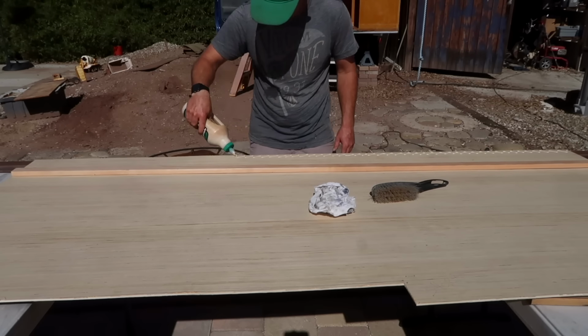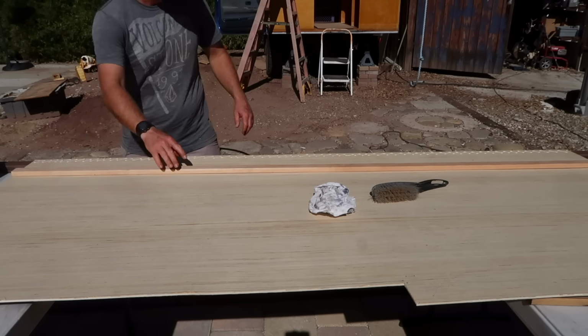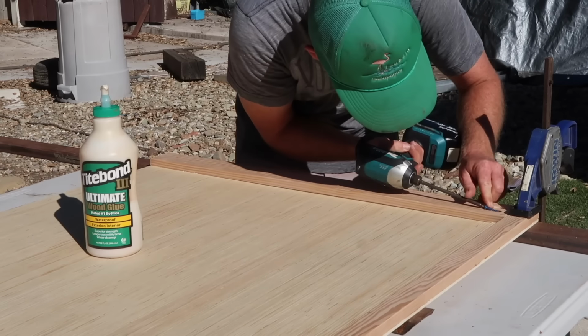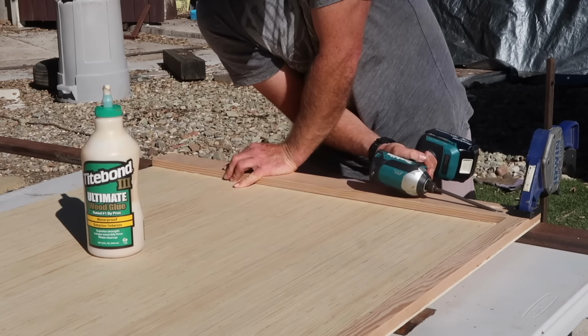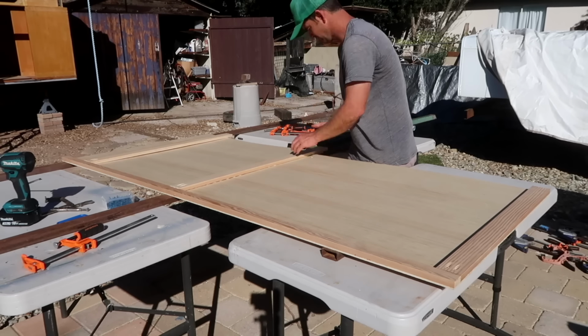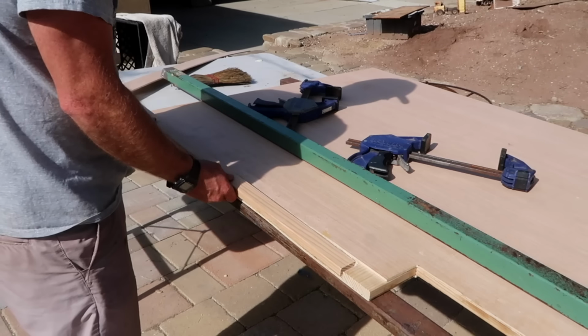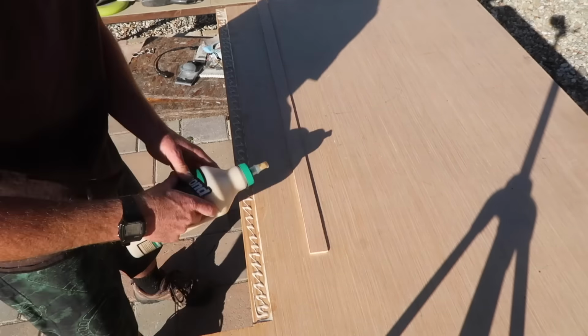Obviously this door is much larger, but it is built with the same process as a utility door. 5mm plywood cut to shape, and a frame of 1x2 and 1x3 Douglas fir, joined with wood glue and pocket screws. Then filled with pour foam before receiving the last bits of framing and a strip of plywood to even everything out.